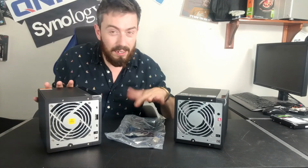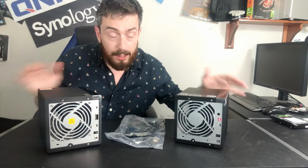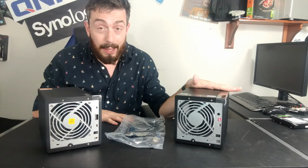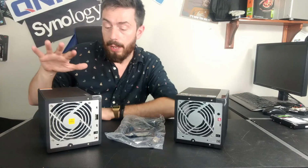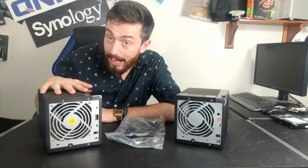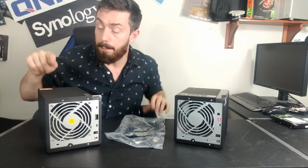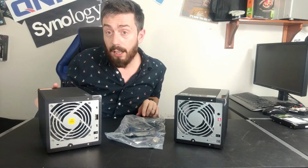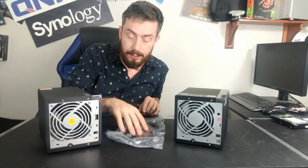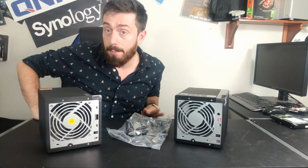and NAS platforms with limited Mac support, it's worth highlighting that as these get bigger and they get more bays, like the 8-bay expansion, the Rackmount expansions, the 6-bay that's on the horizon, the 106 CT, and this has 6-bay, 8-bay, 12-bay and 16-bay Rackmount desktop solutions. As you get bigger, the speeds scale up, particularly in the case of this, where the 1600S arrives with a throughput of up to 5,000 megs, thanks to multi-cabled PCIe connectivity. So that's why they're more expensive.